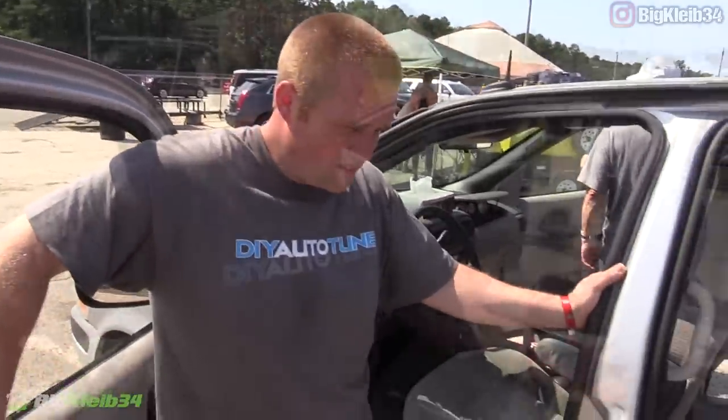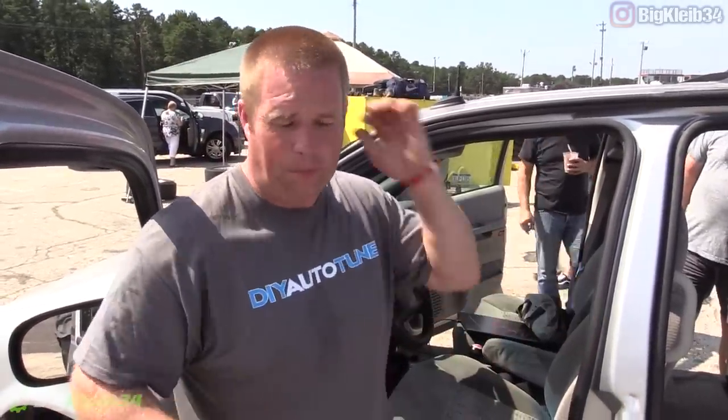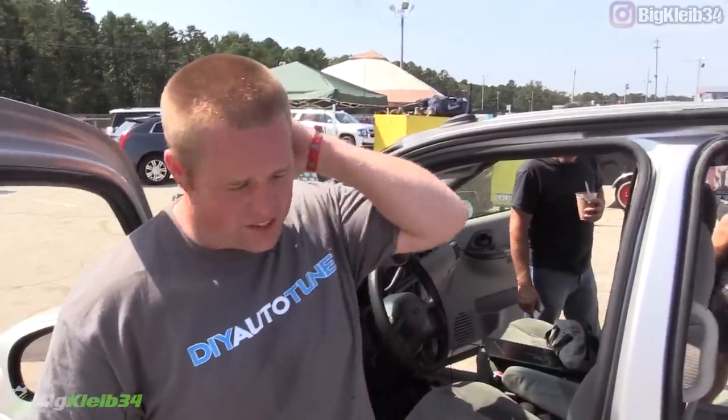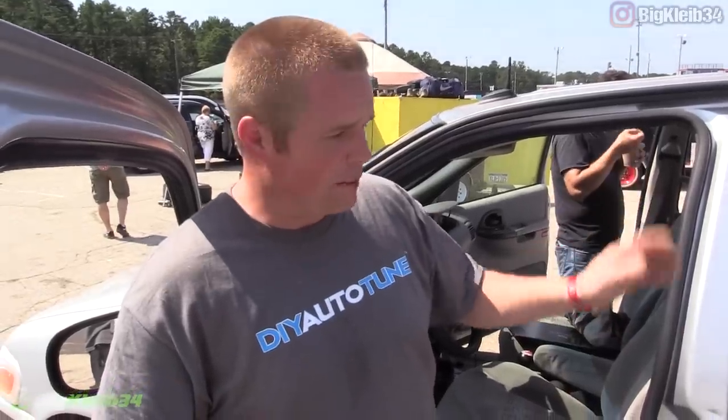Do you have any favorite story with this thing? I was sleep deprived trying to get it here for Drag Week. I started it up and ran it for 10 minutes with no water in the engine. I had a wiring issue — my intent had been to just start it, make sure everything's running okay, and then fill it with water before running it any length of time. I sorted out the wiring problem, got it running, let it warm up, and let it go — probably 10 minutes. I grabbed the radiator hose and felt what the temperature was and it was cold. It should not be cold after 10 minutes — that hit me instantly. I was like, well, this is it, I cooked the thing. I let it cool down, gave it an hour or so, filled it up with water and started it up again, and it's been fine. I'm still a little nervous — maybe some problems from that will surface later. But we put 500 miles on it now and this is the third drag strip pass, so if we had a problem, we would have seen it by now.